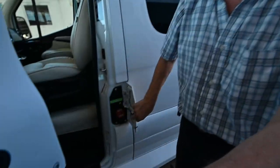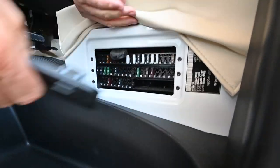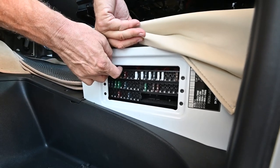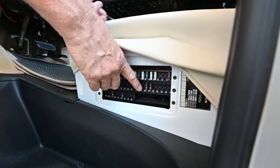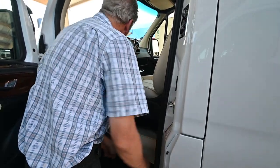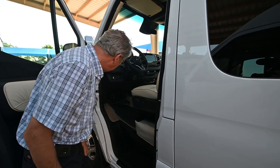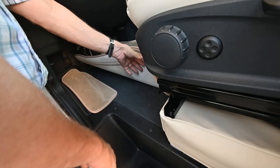I've also got diesel fuel on this side. Over here I want to show you the chassis fuses — these are on the Mercedes side, so you'll find these in your Mercedes manual. There's also some on the passenger side in the floorboard. All these are in the Mercedes manual and they'll tell you which fuse goes to which light, blinker, horn, and different things like that. The battery is actually located here — this is where the chassis battery lives, underneath this cover below the driver's footboard.